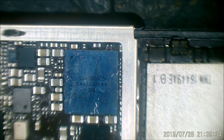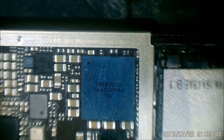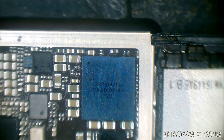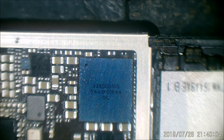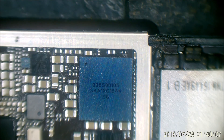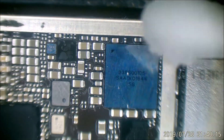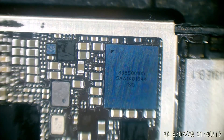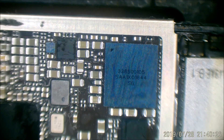Just give it a couple of seconds to cool down, make sure the balls have solidified, and then give it a good clean to get rid of your flux. What I like to do as well is put the phone on the DC power supply and connect it just to make sure we haven't got a short, then do a soft boot quickly before putting the phone in the housing. If you have got a short you'll feel the chip get red hot, and then chances are that phone is coming back to you — so just food for thought. That's it, thanks for watching, like and subscribe.